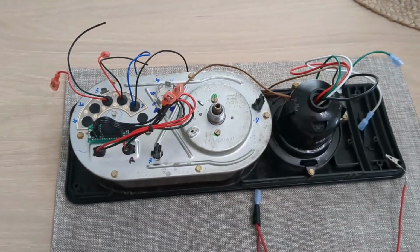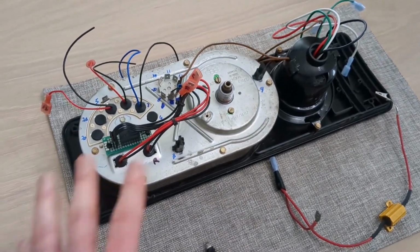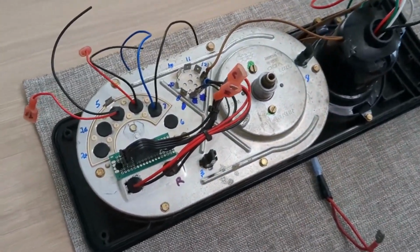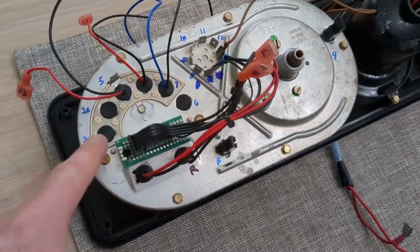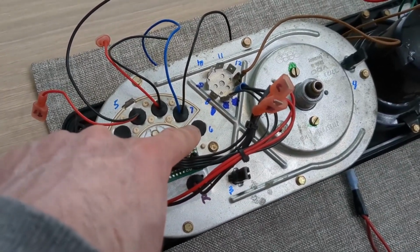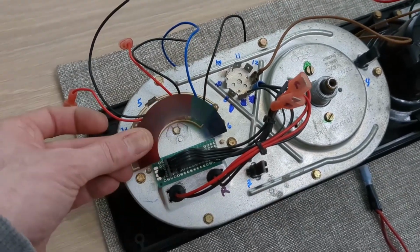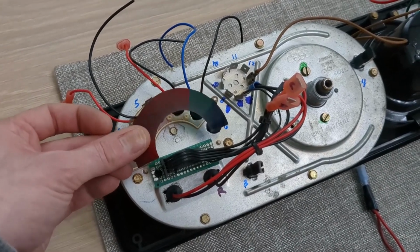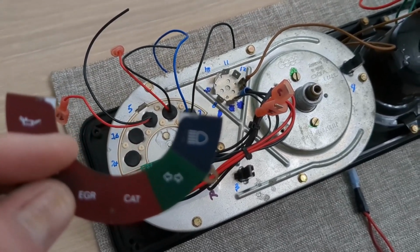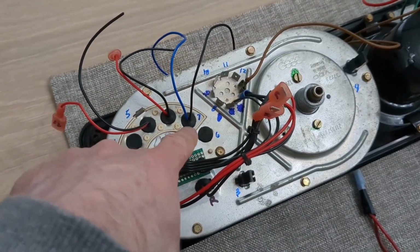Well, I think I figured out the turn signal problem, and this is an issue of I did not fully understand how these indicator lights work. So let me explain this if you're planning on customizing your lights here. If you look at the original cluster of the little dash lights, you notice that one is off on its own and the rest are on this plate looking thing here that has that little surround. If you take the original plating off of it, which was this, you would notice that that number 6 that I have marked there is the brights indicator. And this one is kind of off on its own because it acts differently than all the rest.